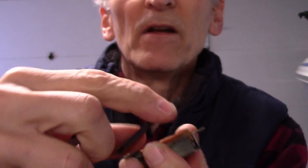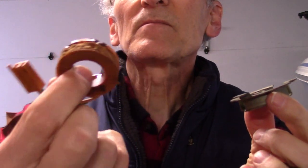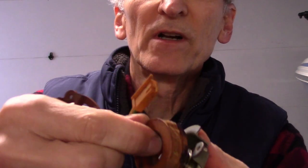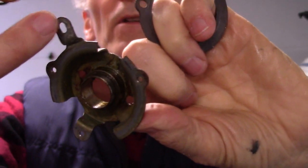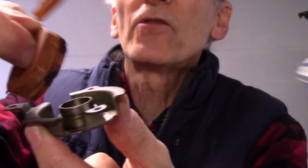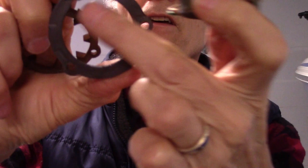Underneath there's another ring, and at the bottom of that you still have the coil that comes out. That's the pickup coil of wire that you want to make sure is good. In the base of the distributor, there's a roll pin that this tab goes over, so you install that over the roll pin. When you get a new one, you get this whole set of parts. You drop the coil in, then the magnet — it's got a recess that lines up with the coil.